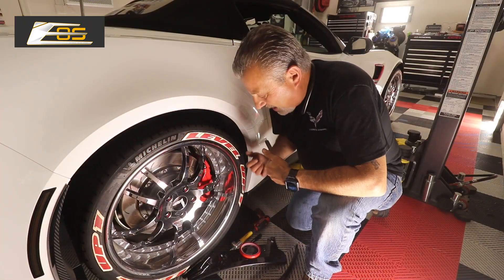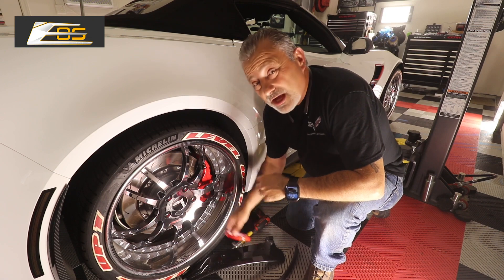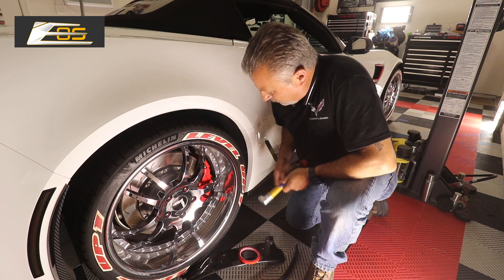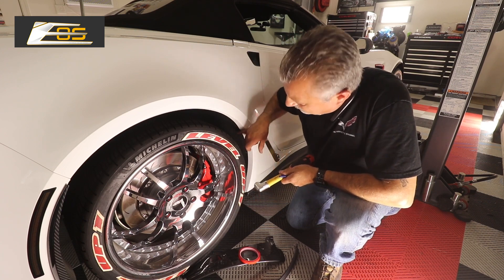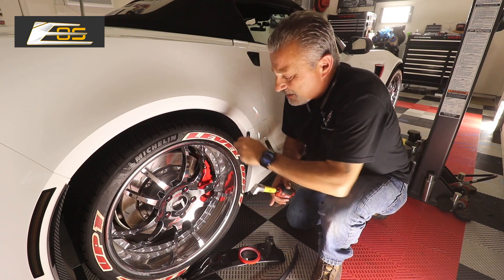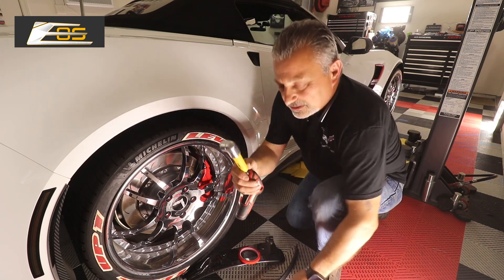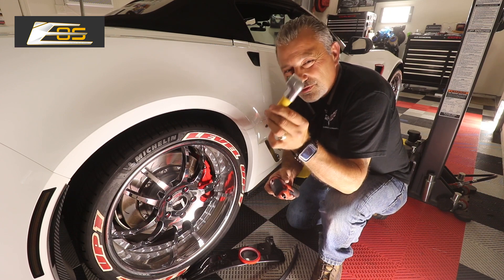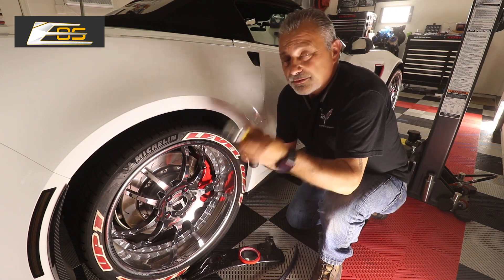We are here at the wheel well, and the only tools you're going to need is an X-Acto knife — a razor knife to cut the two-sided stick tape — as well as a 15 Torx. Now, in order to pull the screws out without taking the wheel or tire off, you're going to need some sort of tool where you can put a bit in and do a 90-degree turn. I've just got this little tool right here — you can get this at Home Depot, Lowe's, or on Amazon. And then I've got a small screw gun.